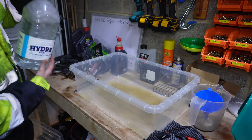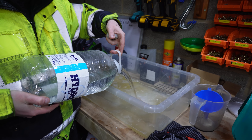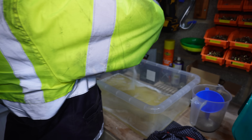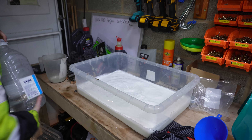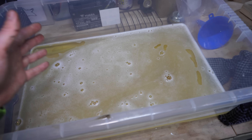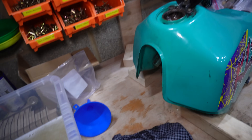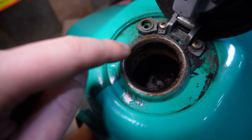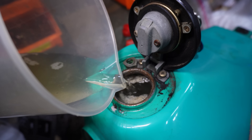All this gave me hope for the tank, but I was going to need more of the solution to fill it entirely. So I started making up the rest of what I had. Here's a little tip if you decide to make this: make sure there's no washing up liquid in the tub before you add the chemicals, otherwise predictably this is going to happen and you're just going to end up with an entire tub of foam. After stirring until all the bubbles melted, I transferred it to fill the tank all the way to the top so it could work on all the rusty areas.